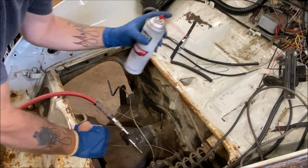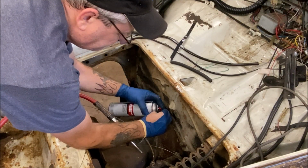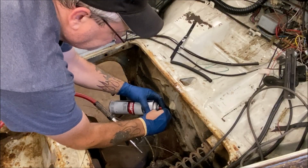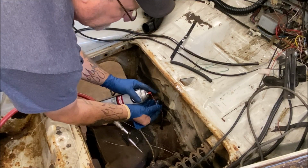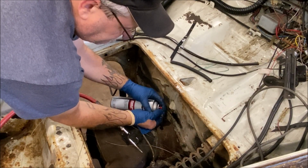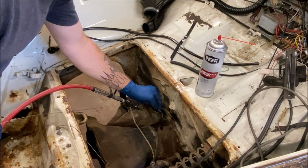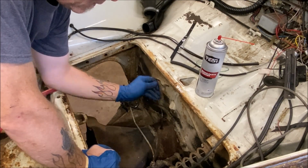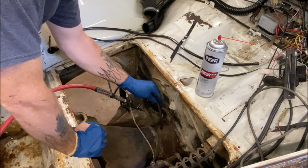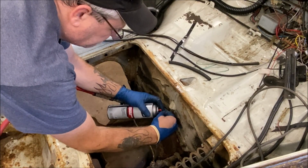Let's start out again by pumping some brake clean in there. Remember, make sure you hold on to this red nozzle. Okay, let's run the throttle cable through one more time. Ta-da. Ooh, this really smells. Okay, well, a little more brake clean. Little more. We'll push it through with that.